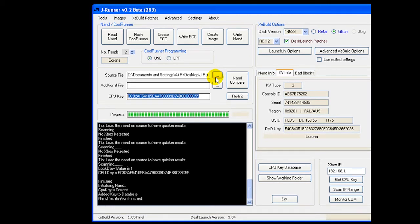What I did was change the network port — I unplugged my network cable from the router port I was using and plugged into a different network port. Eventually, using the different network port, the scan IP range method finally pulled out the CPU key. If it's still not working for you, try a few different network ports and hopefully it will pull out the CPU key.